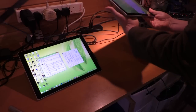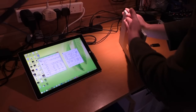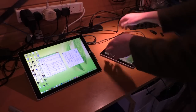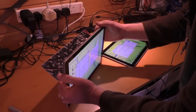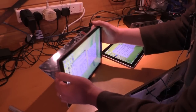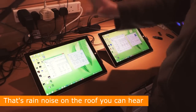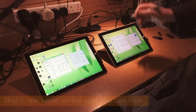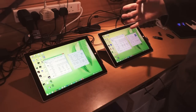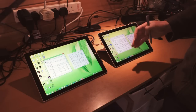Close this bit. There's definitely a hot spot in this back space here, but it's not uncomfortable in any stretch. With this one, the heat is always at this top right corner. Again, it's not uncomfortable, but you can definitely feel the heat and the fans going crazy in there to bring that down. So the Surface Pro is very ready to clock down when it gets too hot, whereas with the 3, it doesn't seem quite so ready to do that. It was able to stay at 2.4 gigahertz, running at 90 degrees, and that seemed to be fine,